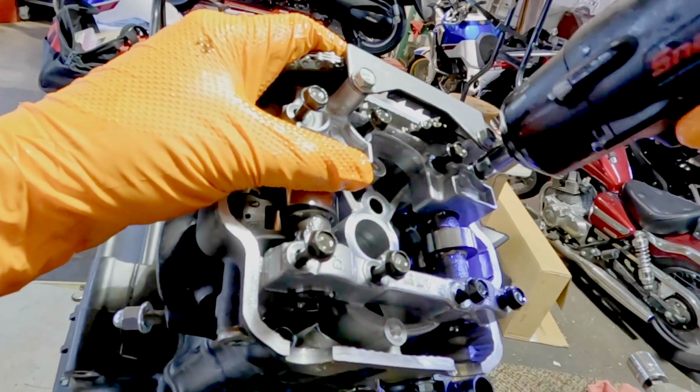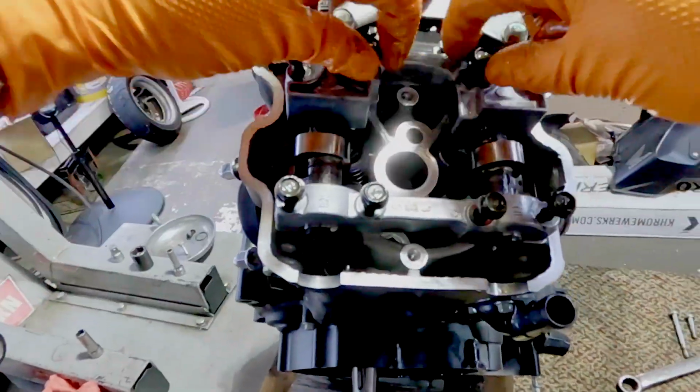Okay, you can crack these things if there's any pressure on the cam, so you want to come off in stages. Here's a cam chain holder. Really easy to install. You can buy them anywhere, and it holds the chain loose for you. And we'll bag those. That comes off pretty easy. This one was a little bit more difficult, but we popped it loose.